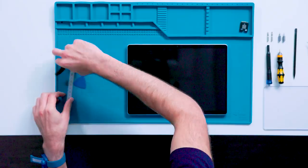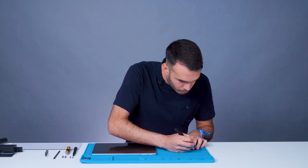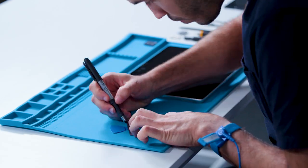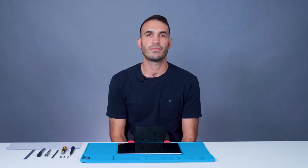Next, we'll work on the display. On Pro 7 Plus, we re-engineered our bonding solution to enable full replacement of the display without heat and allow for easy removal of the display adhesive. We've continued evolving this solution across Pro 8 and Pro 9 devices. We will start by preparing the display debonding tool. We suggest using this tool to reduce the risk of display damage and preserve the display for reuse. We'll use a ruler to mark the opening pick at two positions: 3mm and 8mm. This will help ensure we don't damage any cables during display removal. Mount the debonding tool to the work surface so it is stable during the repair. We will first cut through the adhesive using the 3mm setting and have one last pass at 8mm along the top edge.